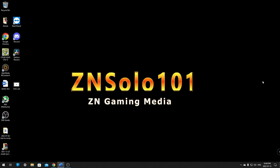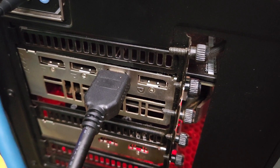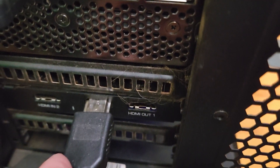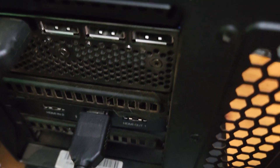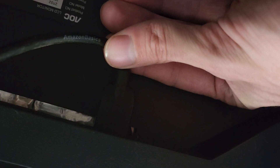The first way is the pass-through. This is the most commonly used for console streamers to stream from a console to a PC, but if you have a 4K pass-through and you're not playing competitively, this will be fine. For this, all you need to do is plug your HDMI cable from your gaming PC into the capture card in the streaming PC, then run the HDMI cable from the capture card back to your monitor.